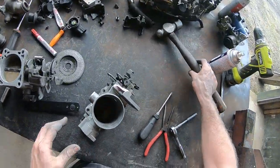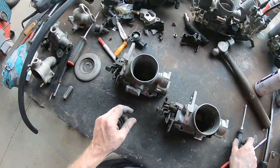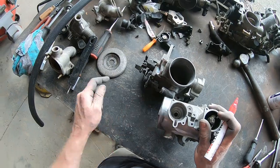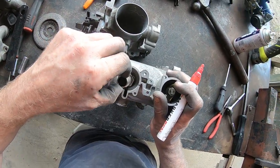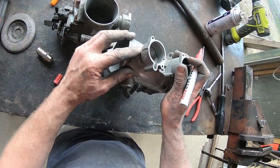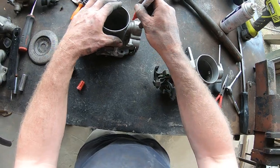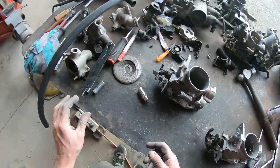Next I'm marking up to take off the sub TPS housing. You want to make sure you've left enough to tap in your brass fitting, or whatever fitting you're putting in there. You can also weld fittings in there if you want, but do make sure you drill out the hole inside because it can cause a restriction. I find the power hacksaw is generally the best way.